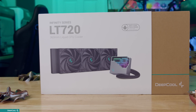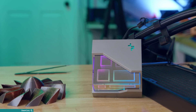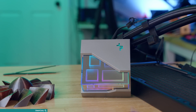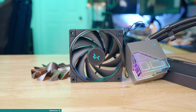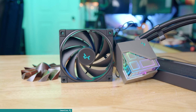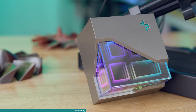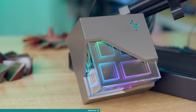This video is brought to you by Deepcool and their new LT 720 liquid cooler. The Deepcool LT 720 is a 360 millimeter high performance AIO with three precision tuned FK120 PWM fans. These three included FK120 fans come in all black and have an RPM range from 500 to 2250. The water pump is covered with an infinity mirror designed enclosure that is compatible with most motherboard RGB software.